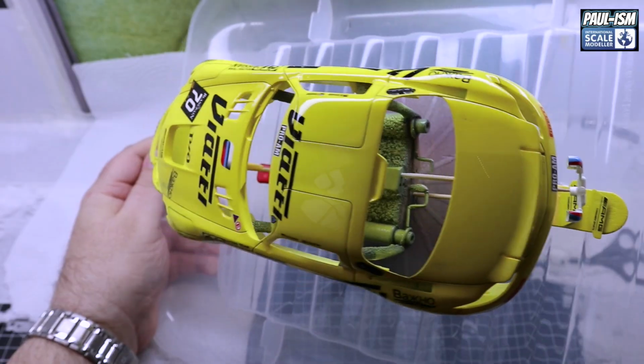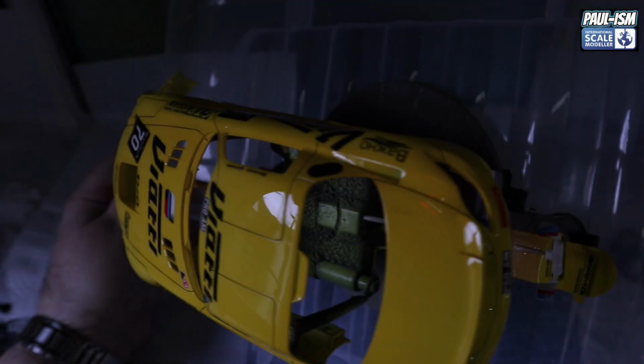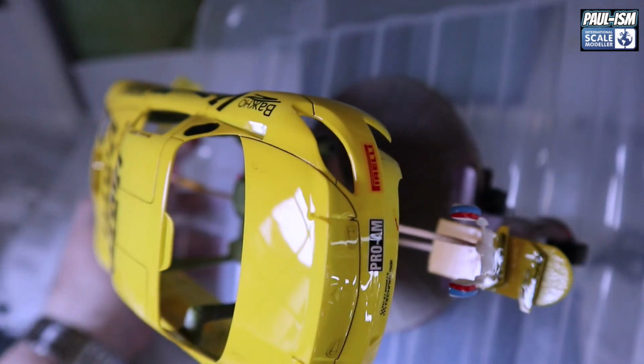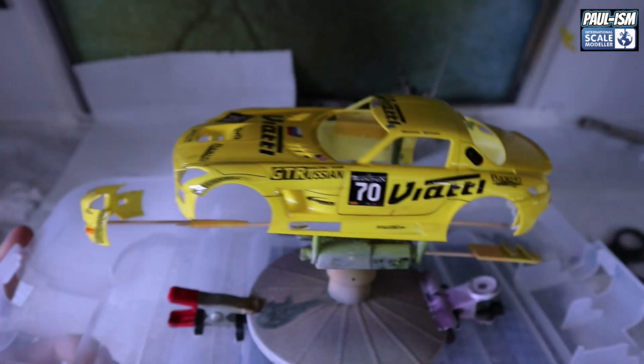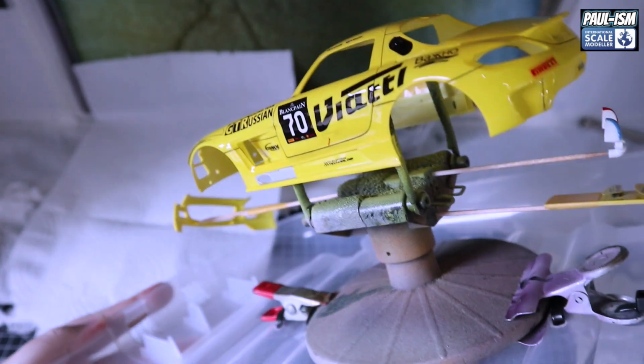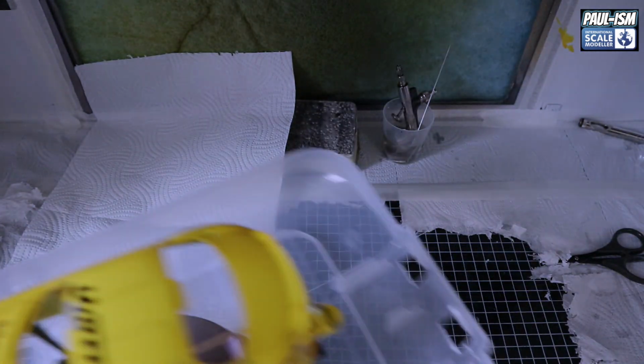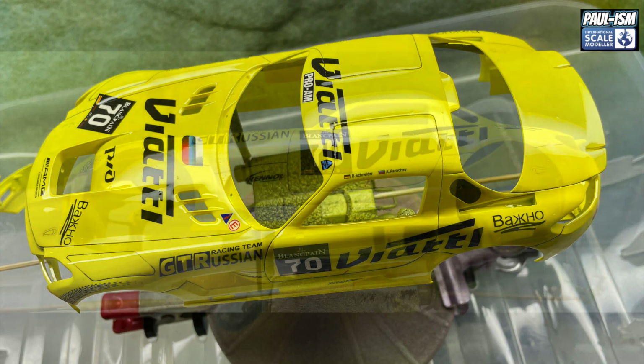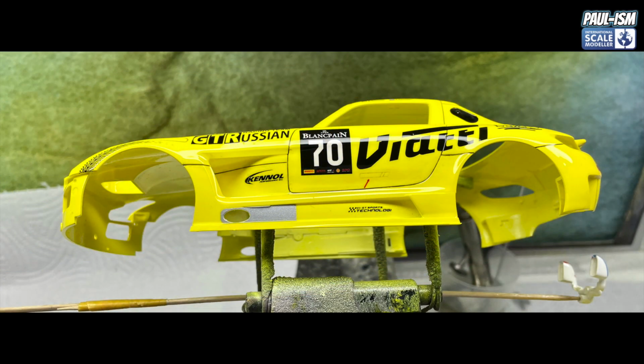But as you see, look at that clear coat. Absolutely beautiful. If I knock the light off, you can see my back door. Very, very nice clear coat. The 0.2mm needle is working absolutely fantastic. Like I say, bar that little run on the rear part of that bumper, looks perfect. I've got some pictures as well. You can see the vast difference under different lights. So this is kind of how it looks to my eye. It's a very luminescent yellow colour. Absolutely beautiful.